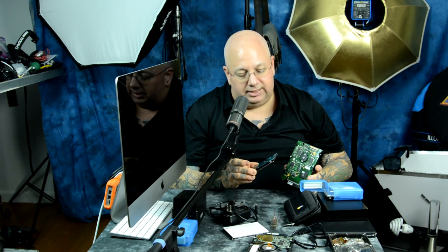You just unscrew it and swap it out. Always keep multiples of the exact same hard drive. If you have a head crash, the easiest thing to do — you have to sacrifice a donor drive — but the only people that have issues with this are people that screwed up to begin with. If a professional has a hard drive crash with all the data on it, it's like 'throw it in the trash, I've got 20 more copies of that data.' Professionals don't panic when their hard drives crash — those who failed to plan are planning to fail.